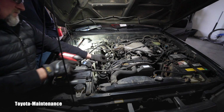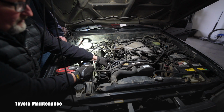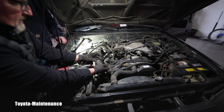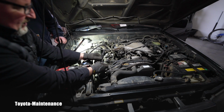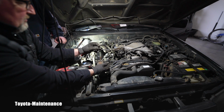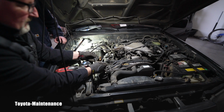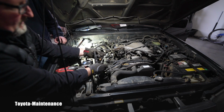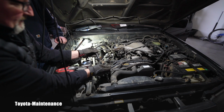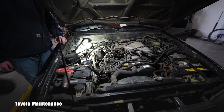Here we go. And Izaak is learning and watching. And that gives me a chance, hopefully, to pull the coil out. I'm looking if there is any oil leaking inside or not. This one is not flooded. The rubber seems to be in good shape. However, maybe there's rust in the spark plug tube. We will see. So this one goes on the side and we will remove the spark plug.